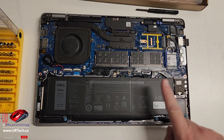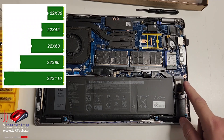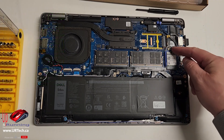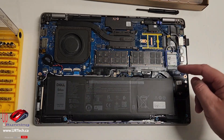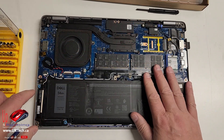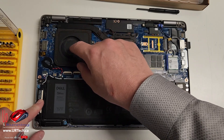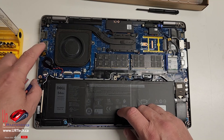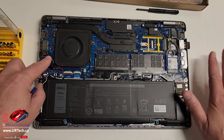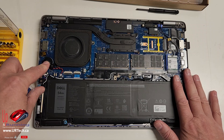Let's give it the quick once over. The battery is here — we have to disconnect it first. That's your hard drive, a 2230 by the looks of it. Just take those two screws out if you want to upgrade it. That's your Wi-Fi — you can tell it's got two antennas; one goes under the keyboard, one goes behind the monitor. RAM you can just pop out like this — easy peasy, pop it in on a 30 degree angle. Whenever you have this apart, you should always blow this out, even if you're just using your mouth, to make sure there's no dust. That small battery keeps the motherboard powered when everything is turned off — it's a CR2032. You can buy them pretty much everywhere, from drug stores to computer stores.